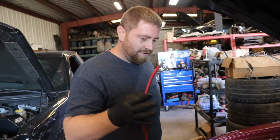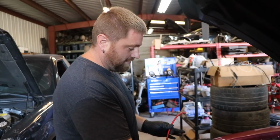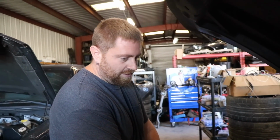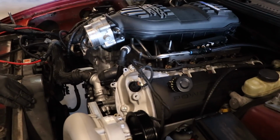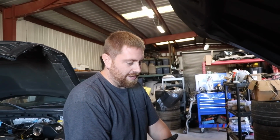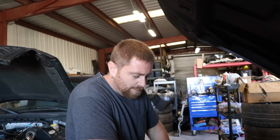It's very similar to what we did for OG. This is my alternator charging wire. I did shorten this because it was here and I was going to have my fuse box here, but I think if I just run it to the factory fuse box and then run power off of that, I should be fine to hook up everything the way that I needed to.